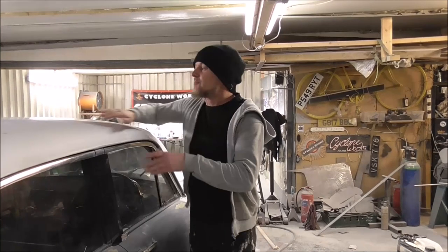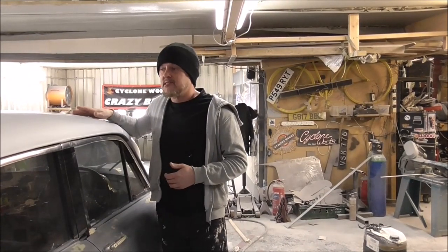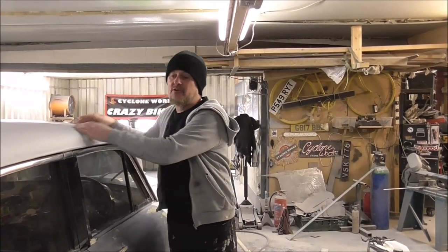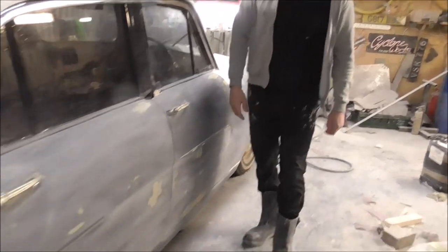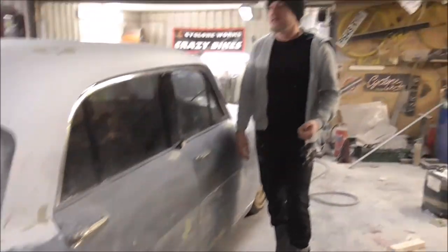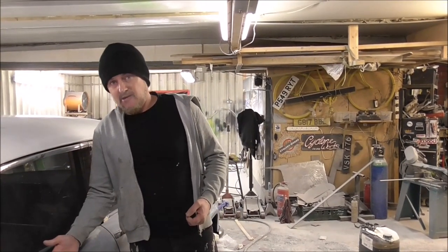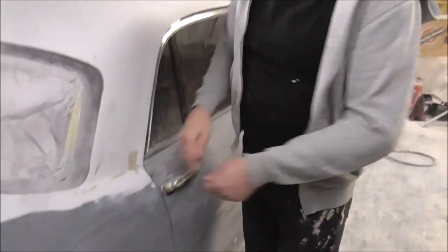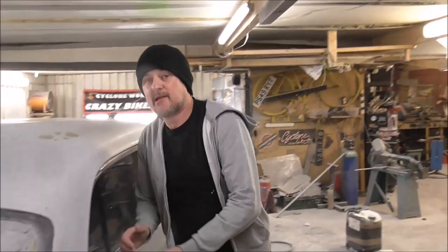Once it's painted and all finished, it's going to be probably a four or five stage paint finish on this. What I'm going to do is leave this overnight, then mask the roof off, finish doing any tiny bits of prep on the body work - it really is pretty much a wipe down and de-dust. Then the day after that I will paint the bottom of the car, then clear coat the whole car as a whole, so that where the paint finish joins - which will be around here - that join is lost under the clear coat.